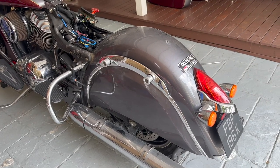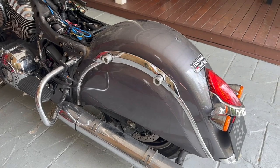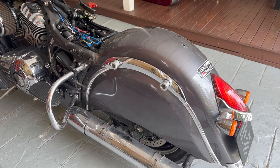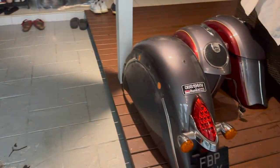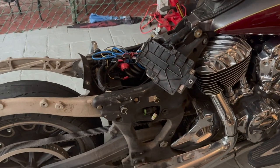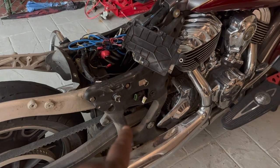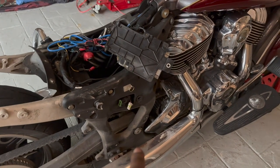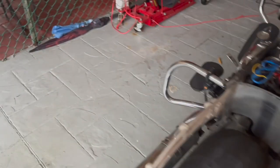I'm going to have to remove the rear fender — I've done this before and there's a video that was actually my very first YouTube video, so I'll put a link in the description. To recap for removing the rear fender: on the right-hand side you'll need to remove the lower panel as well. To remove the lower panel you need to remove the passenger floorboard and the rear highway bar crash bar. On the left-hand side you also need to do similar steps.